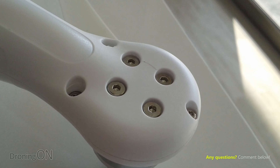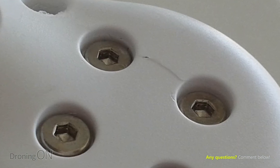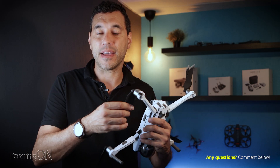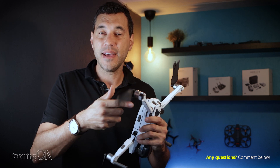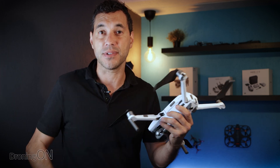I'm sure that many of you remember the arm stress failures on the old Phantom 3, where the motor mounts — where the brushless motors are actually attached to the arm — started to crack. What we certainly don't want to see is that kind of issue occurring on the Mavic, and with the motor swinging that kind of weight on one side it certainly does put stress on the little mounting points of these tiny brushless motors.